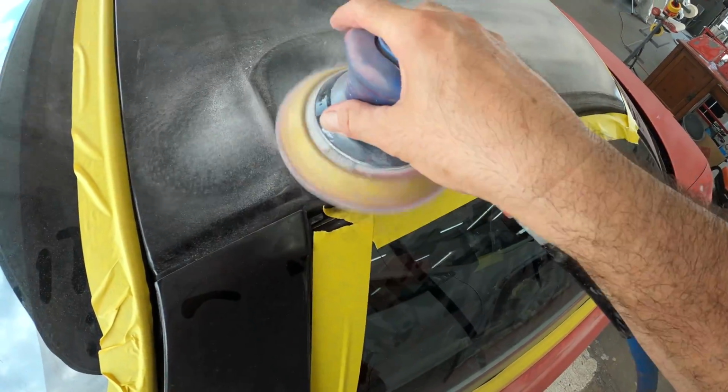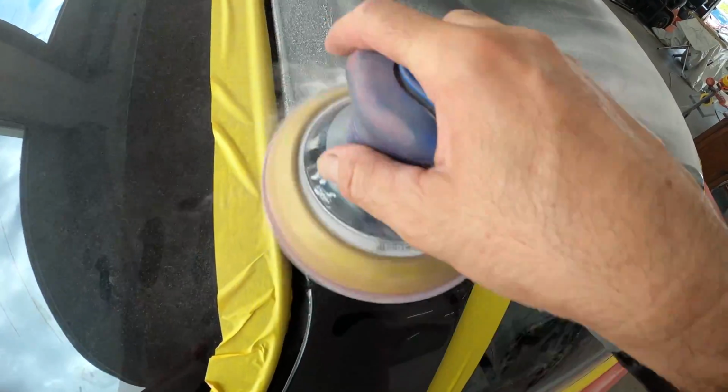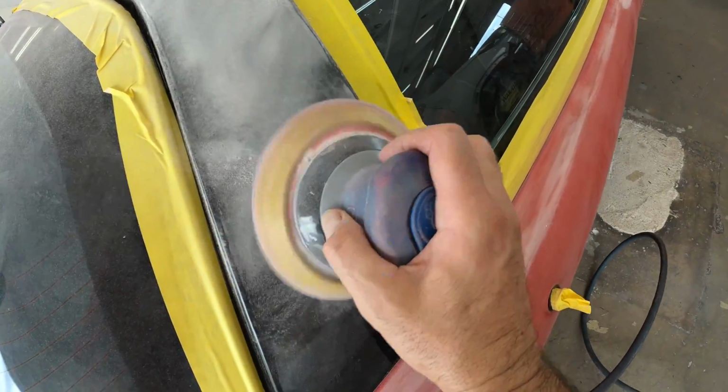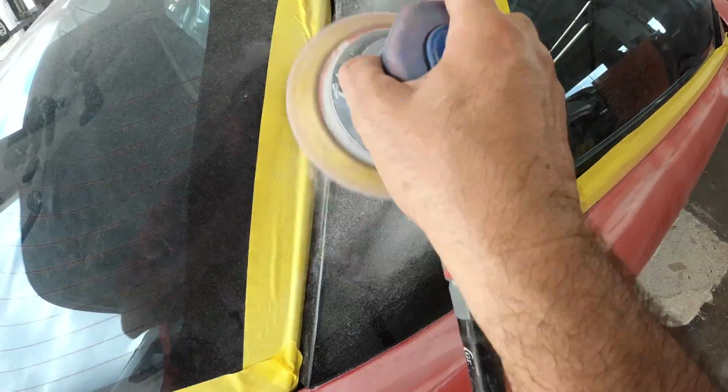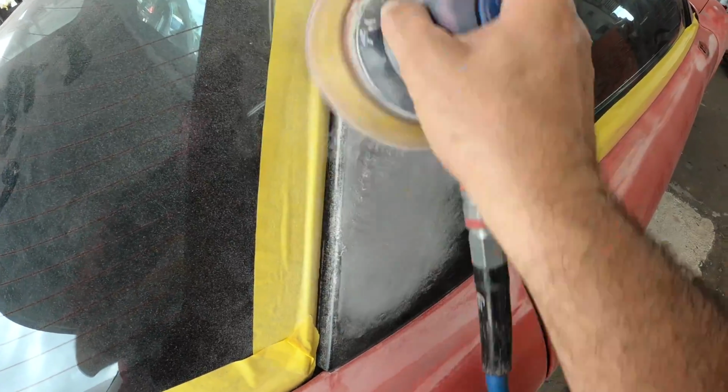A lot of you guys are going to ask, well, you primer some of the car, you don't primer some of the car, and that's where some of the confusion is going to lie, and I completely understand how that can be confusing. All right, so basically, if you're using anything between a 180 to 220 or 320 scratch, it's going to need a primering.